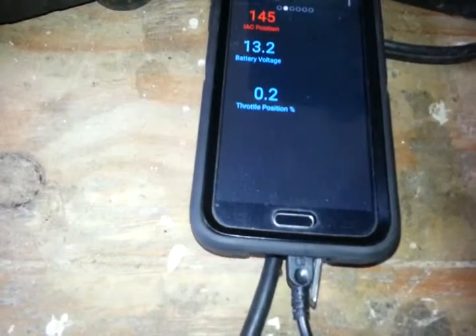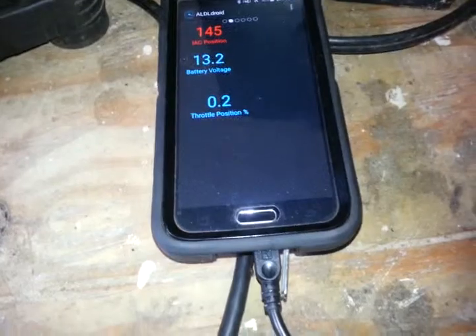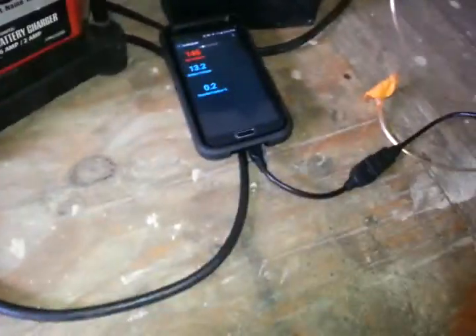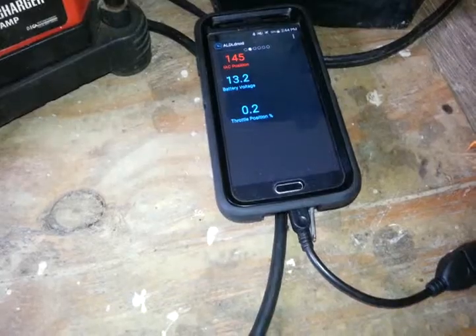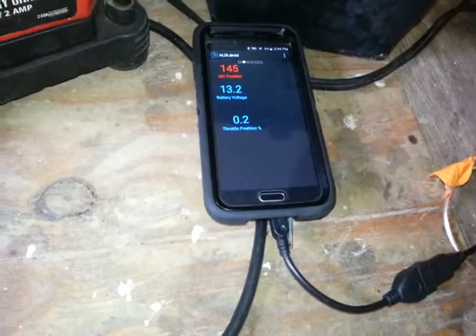It's already almost stand-alone. It's painstakingly slow — 160 baud from that 7747 ECU. It'll respond just like Torque, but this app here called ALDL Droid is $20. The setup is a little harder because you've got to go find the correct definition file to communicate with the ECU. For the 7747 it's the 7747.ADX file — I got that off the forum.